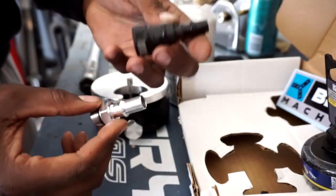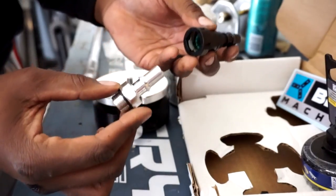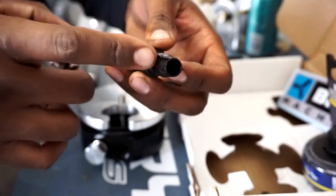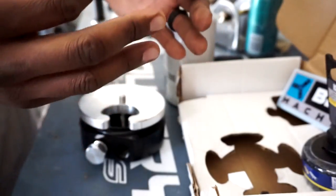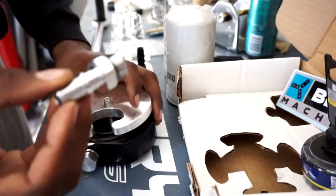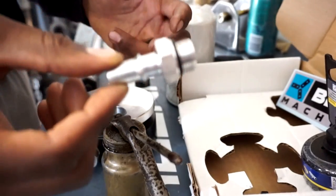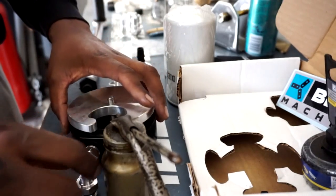For the suction port I'm going to be using this barb fitting. If you have a lift pump, you're going to get provided multiple barb fittings — they've got little barbs on them. This is going to screw into the sump port. Make sure you don't cross-thread it because it's easy to cross-thread aluminum threads. Your fuel line will be on this side and you just snap it in — it's a seal, it's not going to leak. Beans calls for a torque of 25 foot-pounds on the fitting — super light, nothing crazy. They also say to put some grease or oil on the fittings. That ensures the torque is at the proper value when you apply those 25 foot-pounds. Be very careful with aluminum thread fittings — it's super easy to cross-thread, over-torque, or strip out. So take your time, and when in doubt just back it off and try again.